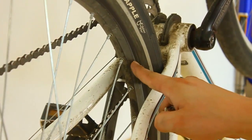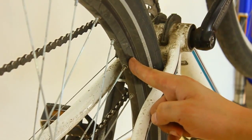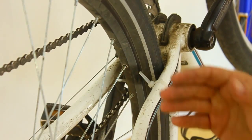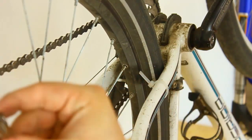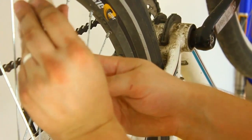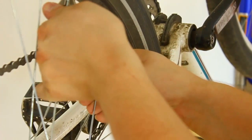We have an area that starts from this spoke and starts again from here. From this spoke to this spoke we can actually tighten all of these. Because it's not a lot of tightening needed — the runout is very small — I'm going to do one half turn only of each spoke. So half turn, half turn, half turn, half turn, and half turn.